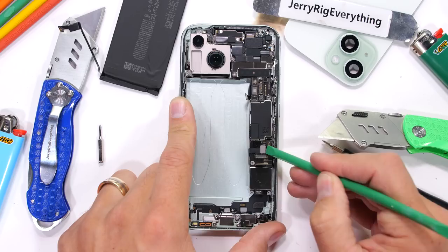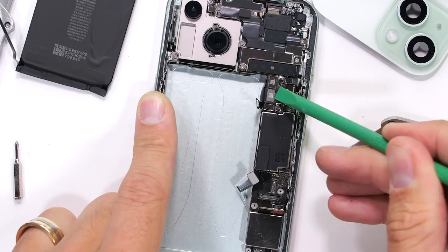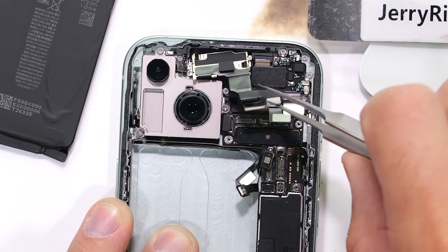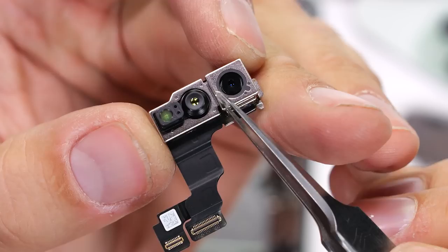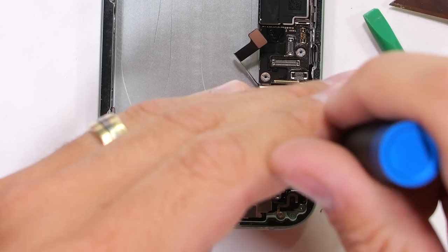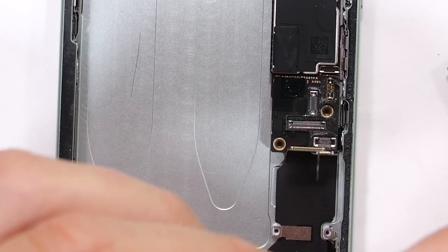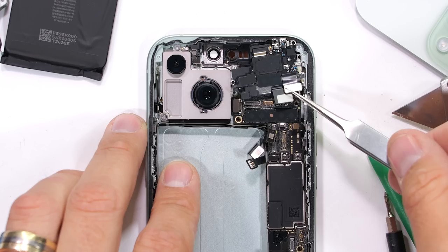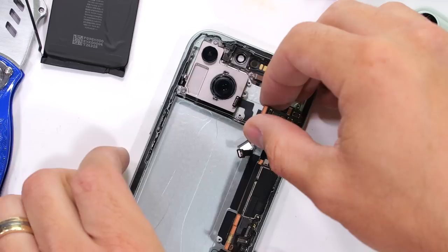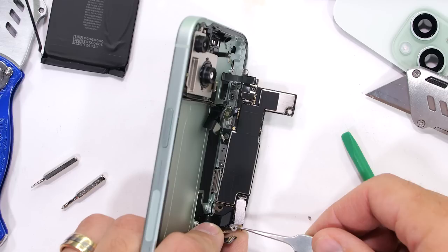This is very different from the iPhone 15 Pro design, which has aluminum on the inside and a titanium exoskeleton on the outside. There are quite a few more ribbon cables and a couple more screws holding down metal brackets. Then we have the front facing dot projector, Face ID, and 12 megapixel selfie camera that all come out attached to the same unit. There is an interesting little box that sits just below the motherboard — this is where the SIM card tray should be. This box is just a placeholder, a space filler, since outside the USA the iPhone variants do still have physical SIM cards. The upper loudspeaker comes out next using a combination of Phillips and tri-point screws, and also doesn't appear to have any foam balls inside. The motherboard has five standoff screws holding it in place, which when removed allows the motherboard to rotate up and out of the frame exposing two ribbons on the backside — these are where the 6.1 inch Super Retina display connects with the phone.